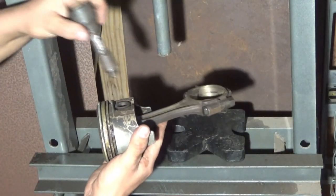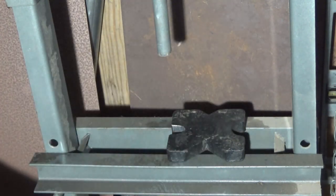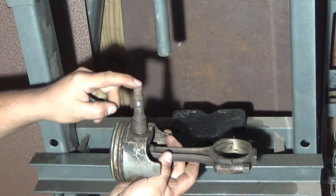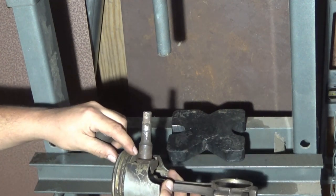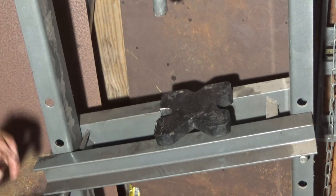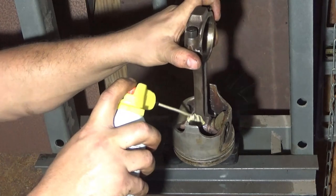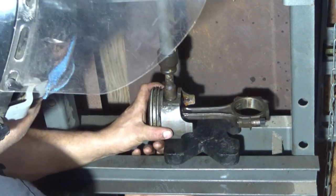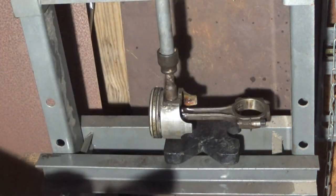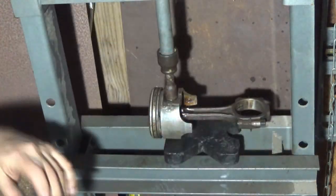So that problem I explained about this going in and hitting — what I'm going to do is once it gets down far enough, I'm just going to take that off and try to press the rest of it out. It's only going to have about that much to go. I got my face shield ready. Before doing this, I'm going to spray a little bit of PB Blaster in there. Got to make sure this is centered — and it is. I just stuck my phone under there on forward camera so I could see it.